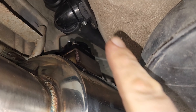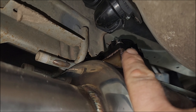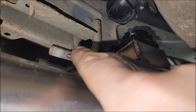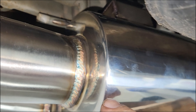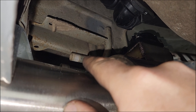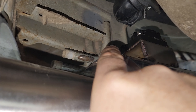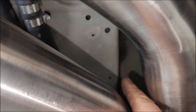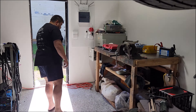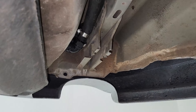We've cleared that issue, but now this bit of material up here is hitting the Varex mufflers - sorry, the motors. So we're going to cut that section out. These hangers are going to be made redundant because we'll need to put a hanger at this end instead. We'll basically nibble it out, bash it that way a little bit so they'll still be there for future use, but the back corner needs to be chipped out so it fits the motors.